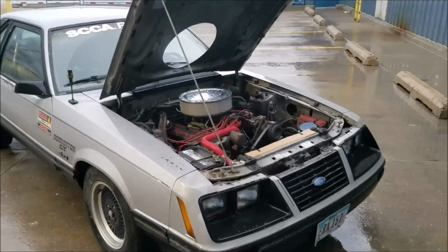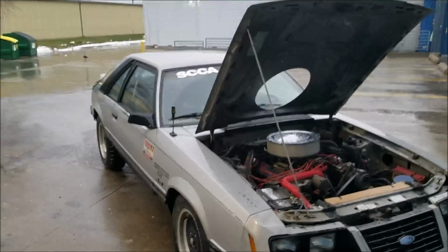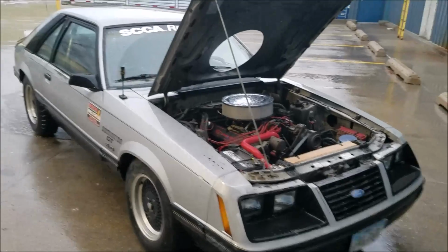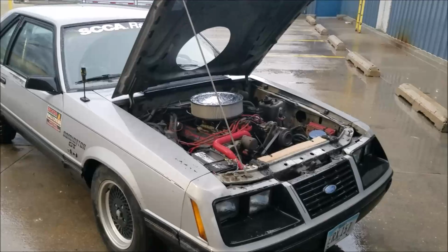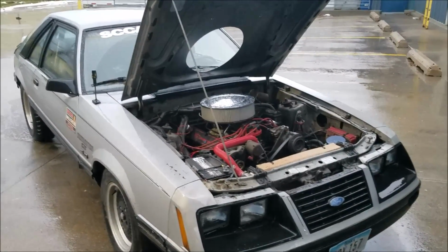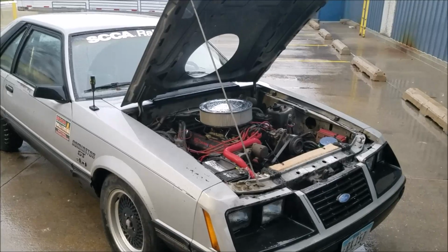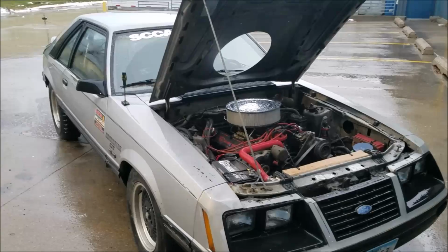and some of the damage it can cause. A little backstory on the car: this car burns so much oil, the bearings are so worn out. Really, it's a wonder this engine even still runs, and it still runs extremely hard, amazingly. But it's so worn out that even with 20/50 oil, when it's up to temp, which it's only got a 160 degree thermostat, it only idles with 20 or so pounds of oil pressure. So to fill that void, I ran 20/50 oil during the summer.